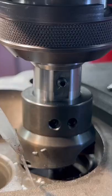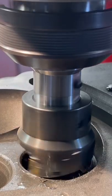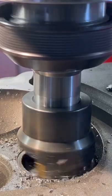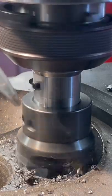We're running a one and three quarter inch OD counterbore cutter on the Serdi, so we can cut these Pontiac heads to install hard exhaust seats. These heads, being from the mid-70s, had the exhaust seat area induction hardened at the factory.